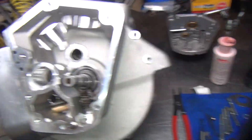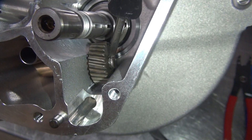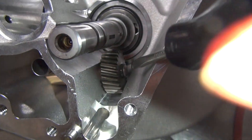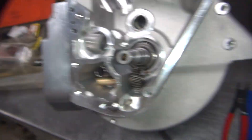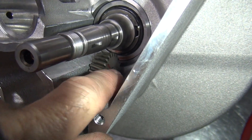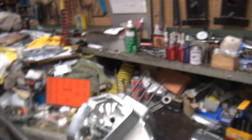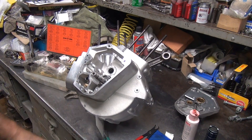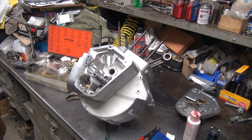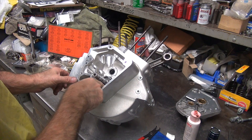Okay, now let's see if it's tight. See how I'm not spinning - I'm actually trying to pump over, trying to move the clip. So now the clip is in there tight. That's what you want - nice and snug like that. Make sure it's in the groove all the way around. You see how the keyway is way over here? I'm nowhere near where the gap on my snap ring is. Snap ring gap is way over there - not quite 180 from it, but I can slip it close to being 180. Usually I got to do that on all the snap rings and make them tight, because they don't make them adequately tight. I've never had ones like that have a problem. I've had the other ones where they're spinning around and come off - the key would go up through the end of the hole and you lose your oil pressure. Not a good sign.